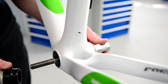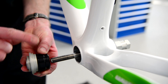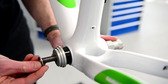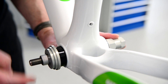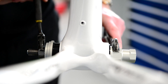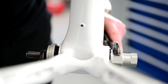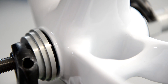Now fit the other cup. The other cup has no bearing fitted into it, and make sure the tool is also inserted into the cup correctly. Slide your washer and nut on and again just gently wind it in — don't go mad, just gently feel it and ease it in. Once you get the cup edge to the frame, keep an eye on the edges meeting and you can make sure you've got it spot on.